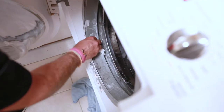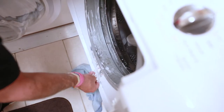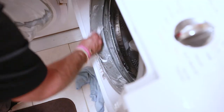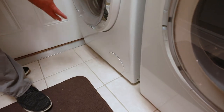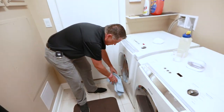Probably the only way this is going to be perfect is to replace the boot seal and then do proper maintenance when you first get a new boot seal or a new machine. But definitely a lot better. If you have any questions, comment below — we'd love to hear from you. This is a really easy laundry hack and it's environmentally safe and safe for the machine. One thing I will note: you may get a little bit of water coming out of the bottom of your boot seal, and that's because of the excess detergent inside the machine. So you may want to just grab a rag and set it on your floor, because you will get a little water coming out of the front of that boot seal.